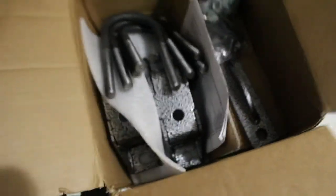So what a flip kit means is that your leaf springs are on top of your axle. What you end up doing is moving those leaf springs to the bottom of the axle — in other words, lowering your truck about seven inches. A C-notch or notch is not required because if you go more than seven inches you'll have to notch your frame, but in this case we're sticking to seven in the back so no notch is needed. The one thing I still need, as I mentioned earlier, is my lowering shocks.